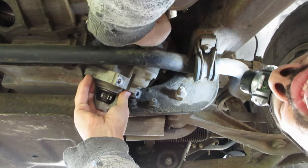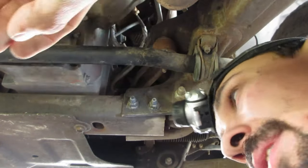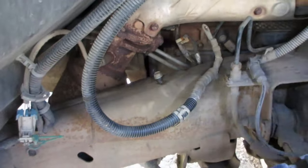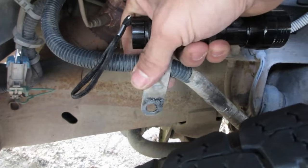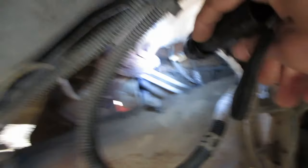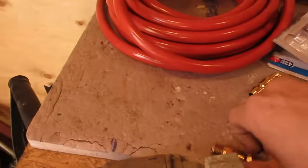Is that it? That's it. Okay, this is way easier than I thought — it's just two bolts, one wire, one connector. Before I forget, there is this bolt here that holds down this cable with the starter, and if you loosen that after you pull the fender out, that will give you more space to move the starter around. That little pigtail there is the only connector you gotta pull off on this truck.